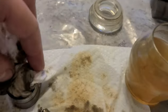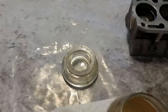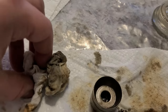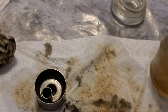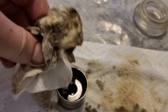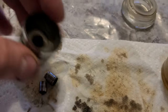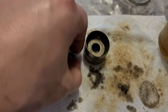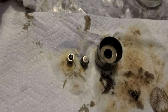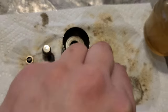So once you start burning oil, it's a sign, not because of the piston rings, but a lot because of the head parts, such as these, or valve contact, or valve guides, or valve seals, you name it, everything. So the head is very important. It's where everything starts, and I want to make sure the head itself is particularly perfect, okay? And everything after comes. So don't forget about the head. You think, huh, there are no pistons, there are no bearings, there is nothing that people usually talk about, but it's actually number one to pay attention to when you rebuild your engine.